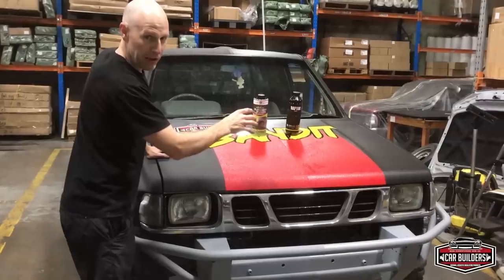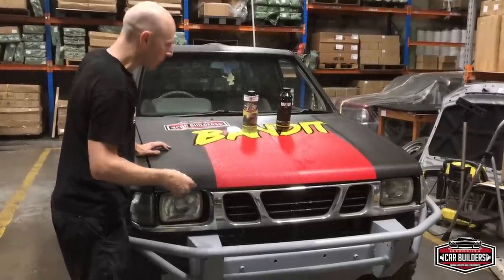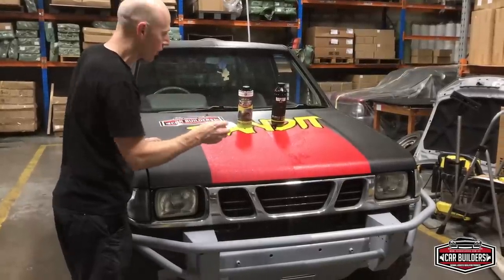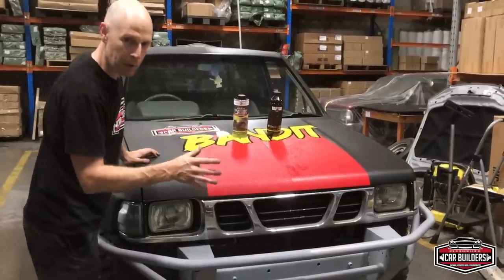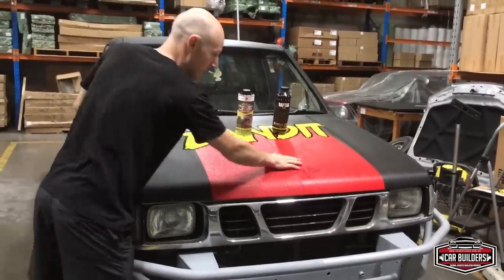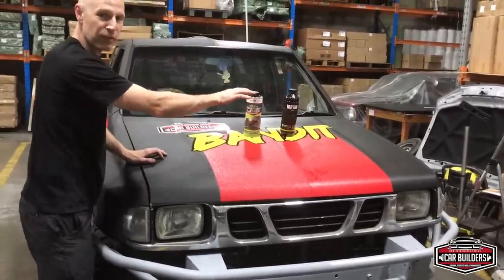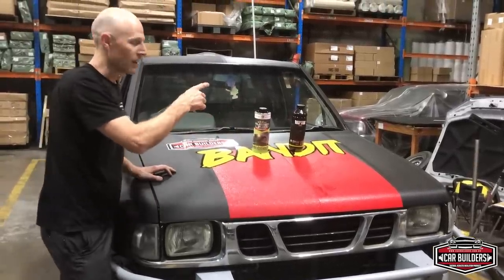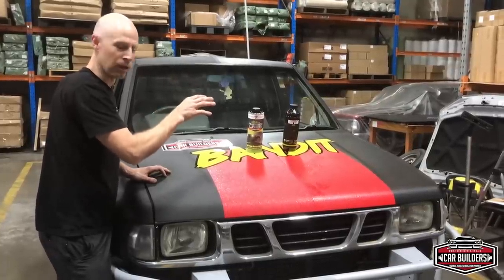The Raptor has a lot of fallout being catalysed. We had drop sheets down. In a proper booth with perfect filtration it'd be fine, but in a DIY environment it's sticking on the floor, sticking to yourself — a little bit more painful. The product is hard. You can see the gloss level — it is shiny. You can add a matting base to dull it down, but you've really got to be conscious of gloss level and patchiness when you apply it.